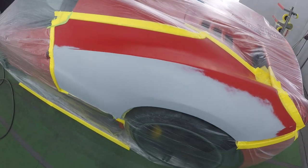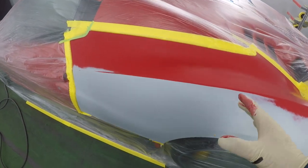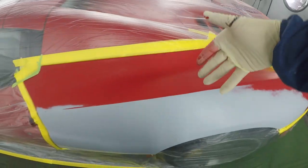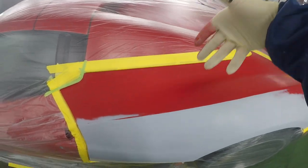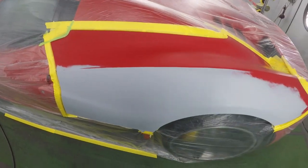So we're going to spray two coats. I just cleaned it with wax and grease remover. Watch my gun — I'm going to try and stay away from this edge and this edge completely. I'm always going to point my gun away from those edges. When I'm spraying the top here, I'm going to face it down so we don't get any extra overspray going that way.